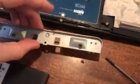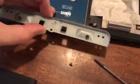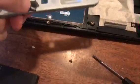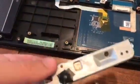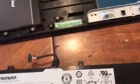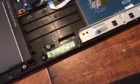What we have on top of this is a piece of metal with a groove in here so it can contact and hit that button as it comes down. It touches this, and I'm basically adding cushion. I'm using electrical tape because it's a thicker layer than some other regular tape. This computer only needed two layers and this one I'm using four because just two wasn't enough. I guess it depends on your condition of the mouse pad. Hopefully this works and I'll put it back together and show you guys this mouse working.